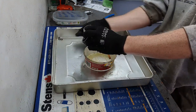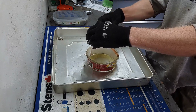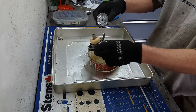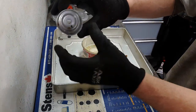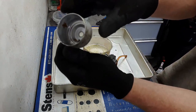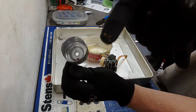And the bowl nut is just that, it's just a nut. Doesn't serve also as a jet at all. Alright, so let's show you what the inside of this thing looks like. So just in the bowl itself, doesn't look too bad, except for look at that jello in there. That's old ethanol gas, guys.